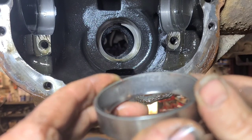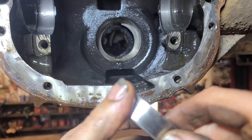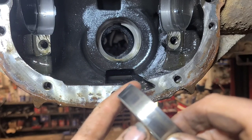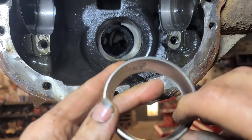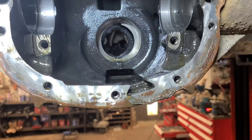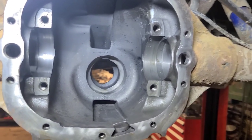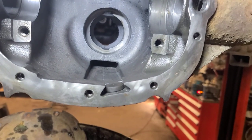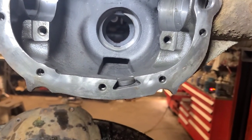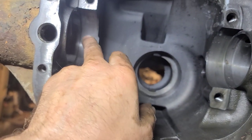You can see that bearing and how it failed. I'll find that spot on the bearing where that little piece of metal was jammed in. I'm not sure if that contributed to the bearing failure, but it certainly wouldn't have been good for it. There's the differential housing all washed out. I found a magnet from a power steering reservoir and stuck it in there - there should be a magnet in there. Somebody must have taken it out and never put it back.